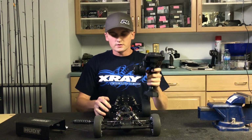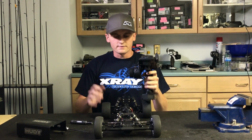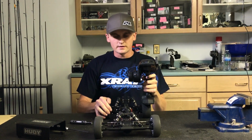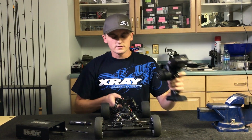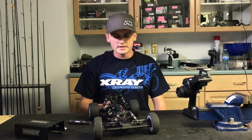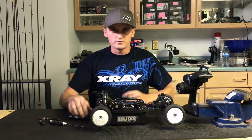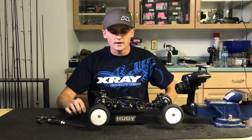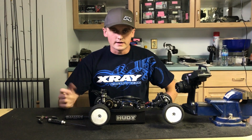So I'll tighten it a little bit. Again, you want to go a little bit at a time, so you don't go too tight and then have to back off. It's just easier to do little by little. So that's about what I'll do. Pretty standard. There is the occasion when you need to have it looser, if it's a really loose track with not a lot of jumps, but if there are a lot more jumps, where you need to come out of a corner and really get on it, I'll run it tighter.